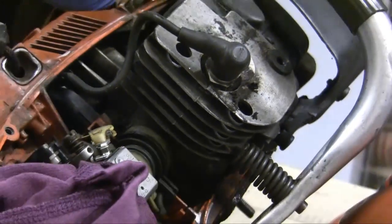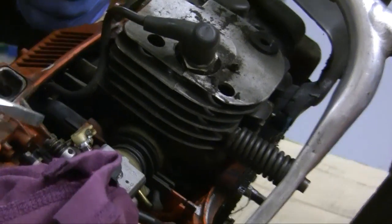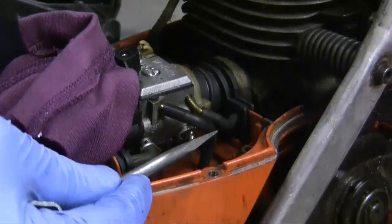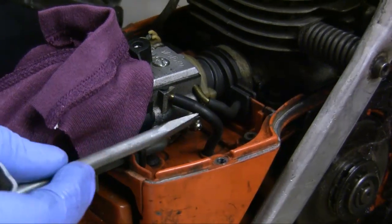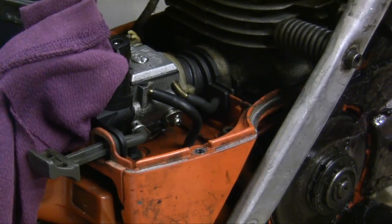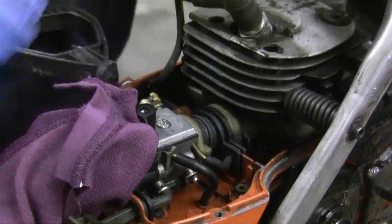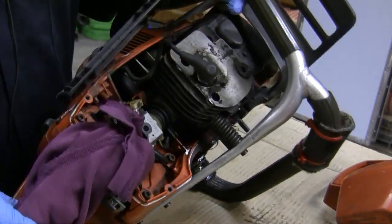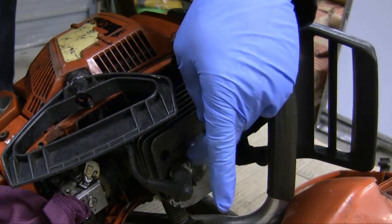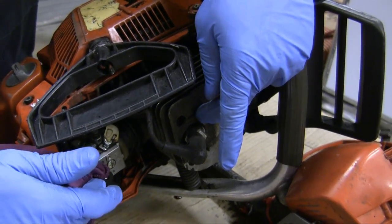This saw has seen a little bit of work recently and just needs to get cleaned up. I'm also taking a general look at my linkage — these hoses direct fuel to where it needs to go, so I'm checking that they're not cracked or leaking. I'm also making sure that my choke hardware and linkage is working appropriately. For now, I'm going to leave my spark plug in place because it protects the cylinder, for the same reason I've plugged the carburetor throat. Then I'll move on to further disassembling the saw.